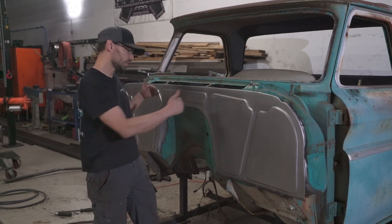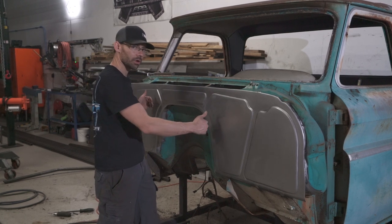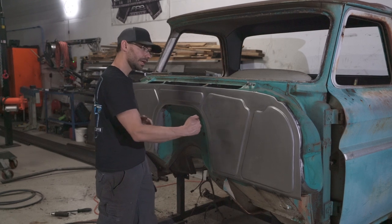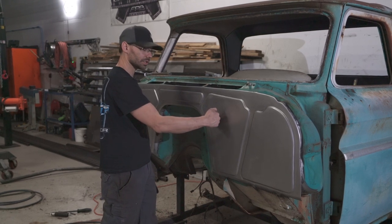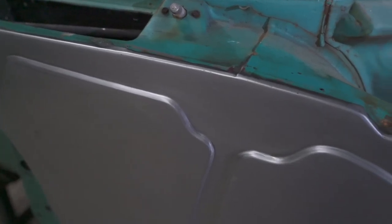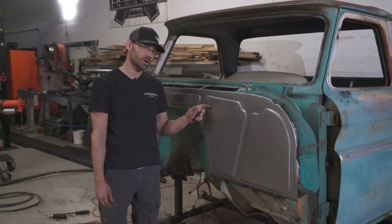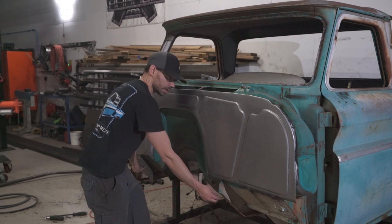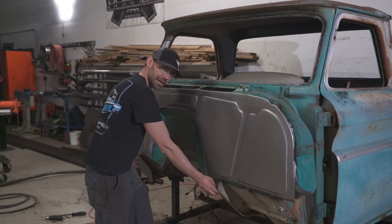And we chopped off that front layer of the firewall, so we actually gained about 1.25 inches of valve cover clearance, and that'll let the master cylinder, the brake booster, sink back about 1.25 inches. So all we have to do next is shorten the brake pedal bracket, the push rod arm, and we gotta redo these, we gotta kinda cap these brackets off down here.